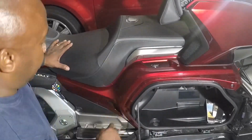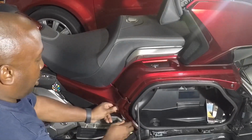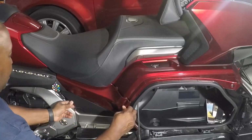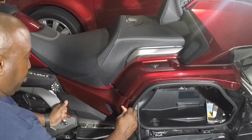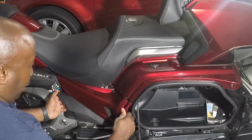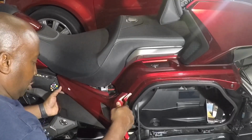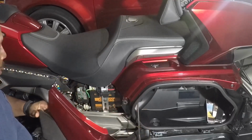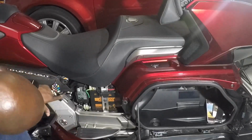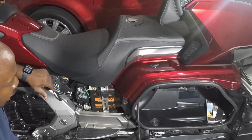To open these up, first start by, when you let those down, pull at the bottom and back of this, pop them out. Pull at the front edge of this, it should pop right up. Work that out. Comes right off. Seat bolts are right between here. You look down in there, you'll be able to see the seat bolt on both sides.